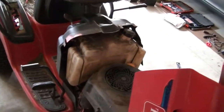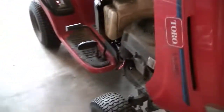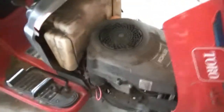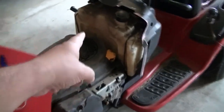So that's the place where a fuse is present, and that blew off, due to which there was a no power situation in the whole machine, nothing on the dashboard. This turned completely blank and nothing was happening when I turned on the key. Just wanted to share that information in case you experience a similar issue, because everything else was fine, the solenoid and everything was fine, only that fuse blew off, and the location of the fuse is behind this tank.